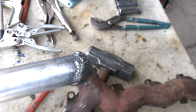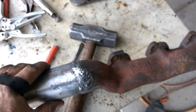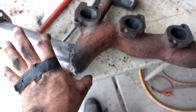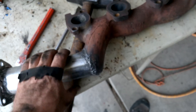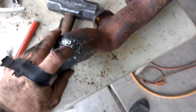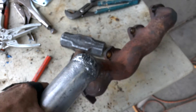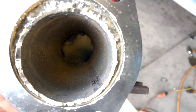Here is the brute beast — that was a real fun section to weld. I had to heat it up because this was a funny angle right here; it used to kind of go this way with that big old coupler. Once I got it tack welded, I had a gap and the angle was all funny, so I just heated it up with the torch and bent it over and then welded it up. It looks pretty good actually for what it is.